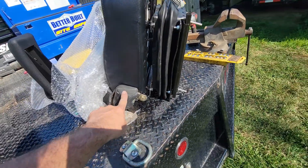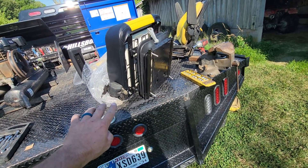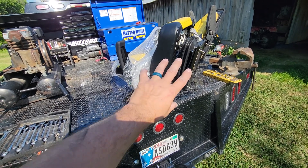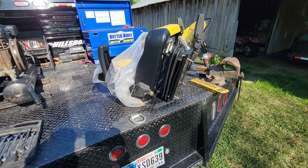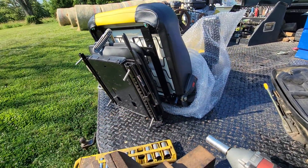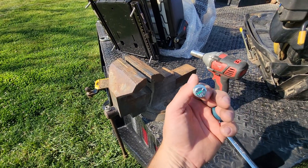I did have to move the seat belts over from the old seat. One thing I was curious about was whether the new seat could accept the seat belts, because from the pictures online there was no spot to put those — it showed a plastic piece over there. The guy at Seats Unlimited said if you don't want it, send it back. So I took a risk on it, and sure enough, everything's there. One side even had hardware, the other didn't. I reused the John Deere hardware because it's actually grade 8 stuff, whereas the replacement hardware is grade 5. It's fine thread.